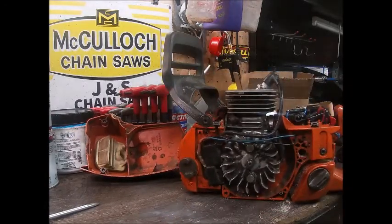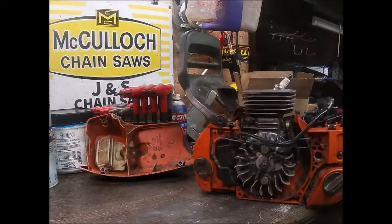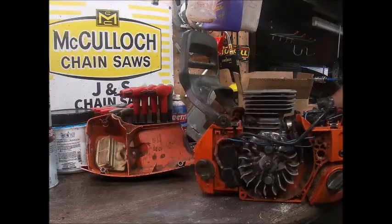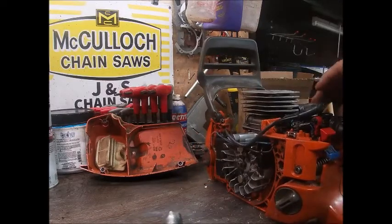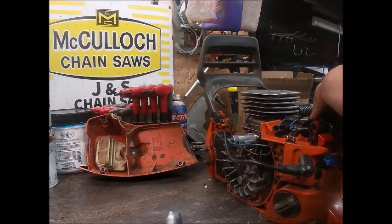With a good safe four-stroke, it would only turn like 11,000 out of the cut. I could get it up to where it would touch 11.8, but it was just so lean there — I wouldn't have left it and ran it there at all. If you've ported saws a lot, you'd say 109 looks pretty dang low and you should have known it wasn't going to be real high. I did go back in and moved it a little bit — like three degrees. When making adjustments, make fine adjustments, not large ones. Don't go in and cut 100 thousandths out of the port; make little small adjustments and see where you're at. What little RPM I picked up from that movement kind of made me want to go ahead and swap over to the 346-style cylinder.